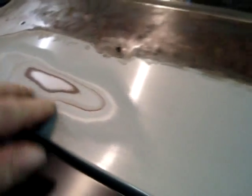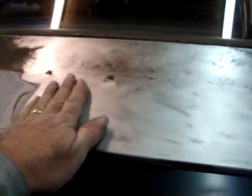I'm cleaning up the top edge now. No surprises — we had some pits but neutralized those. The camera is not going to really pick this up, but that's about a quarter inch thick of body filler right there, all the way across here. It tapers up to nothing on one end but they've got it in the middle. The surface underneath feels nice and factory straight, so I don't quite know why the filler was put on there, but we're taking it all off.